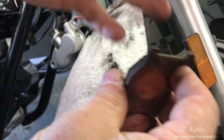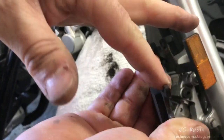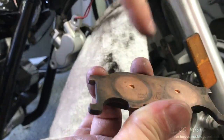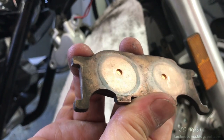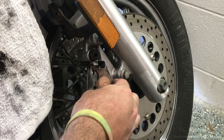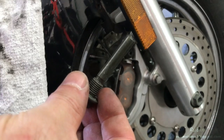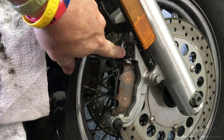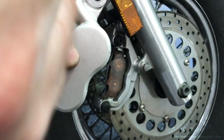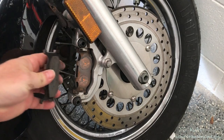I've cleaned up my brake pad since it has a lot of life left. What I do is use the tiniest drop of anti-seize on this portion right here, and on the back where the piston faces touch — just enough to color it, a tiny amount. If you don't feel comfortable doing it, don't do it. I'll reinsert it — the top one is now finished. If these are looking dry, I'll put a little bit of grease in these dust caps — just a half pea size right here. Holding the caliper, I'll now remove that support wire and, having prepped the other brake pad like the first, slide it into position.